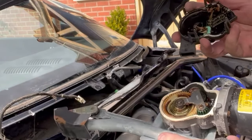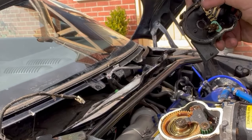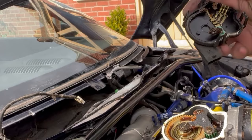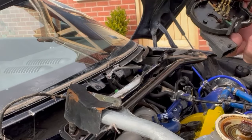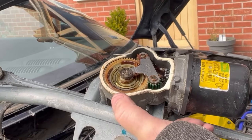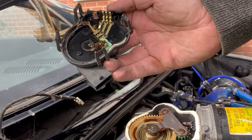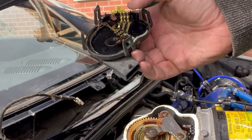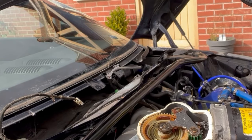There's some kind of gasket silicon seal in there. The issue in question is that little contact there — that needs to touch that little tab there. So we're going to give this a good clean up. It all looks relatively good inside the motor, plenty of grease in there. I will work some more grease in just in case, but we're going to give these a nice tidy up with some electrical cleaner and re-tension the points, then put it back together and hopefully we've got working wipers.